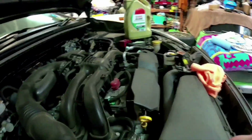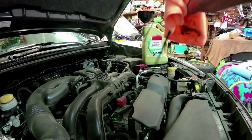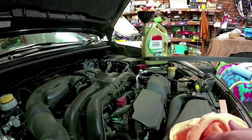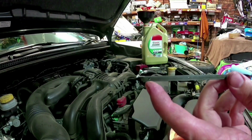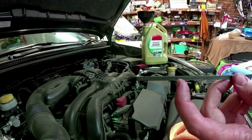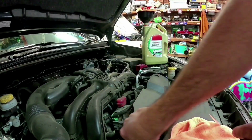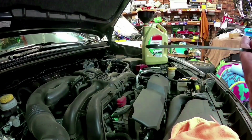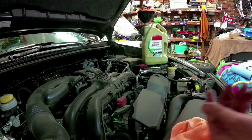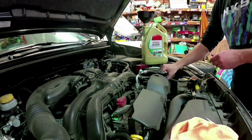We'll jump out and we'll pull the dipstick out here. Now on your dipstick, you've got two little holes. So that's your low level, that's your high level. So you wanted to get it around about there, like either a little bit above or right on the dot. And that's spot on. So wipe that, put it in, put it back out again. See, that hasn't even registered on the dipstick. So we need to add a little bit more to it. So we'll chuck some more in.